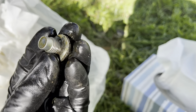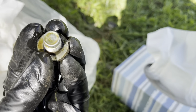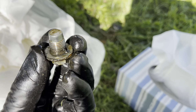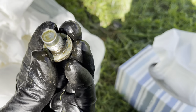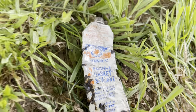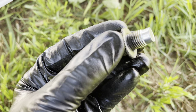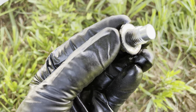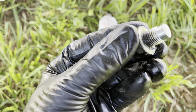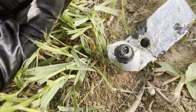I'm going to wipe the drain plug off with some tissue, totally clean it, and then put some form-a-gasket at the very base — it won't get into the engine and means we don't have to tighten it as much. Apply it right at the base; you can see where I've applied it before. It ensures nothing leaks and holds the bolt in place. If you want a magnetic plug, use my Amazon link in the description.